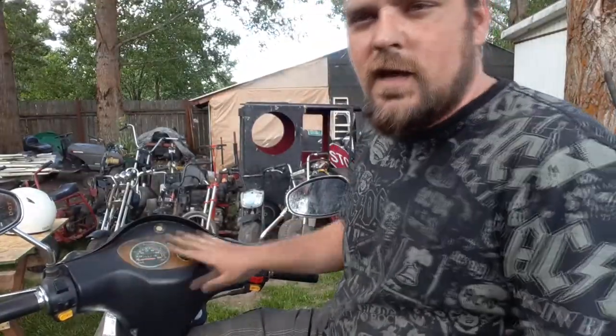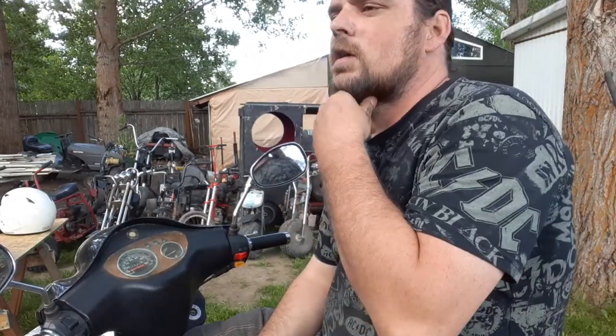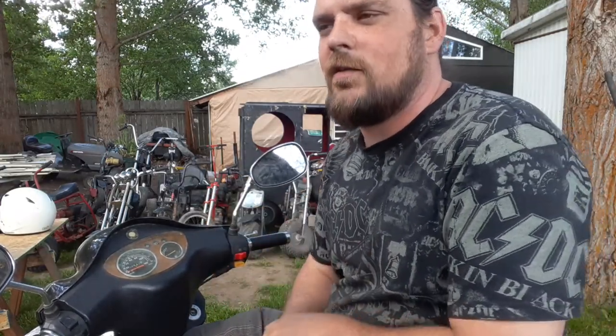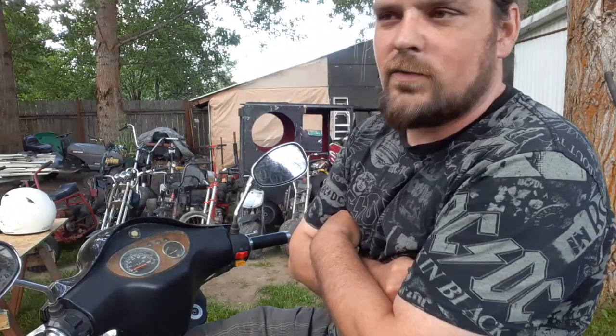You can definitely fix your own scooter. Like I said, that sound I heard — that's a good way to indicate something's up with your clutch. So if you're on the throttle and you hear like a g-g-g-g-g or some kind of weird chattering sound, chances are maybe your clutch is coming apart like mine. Alright you guys, I think that's enough footage for one video, so you guys take it easy.